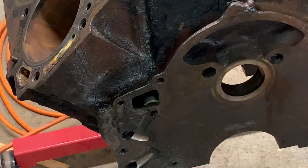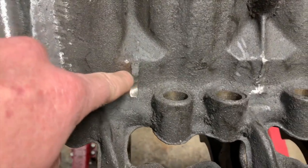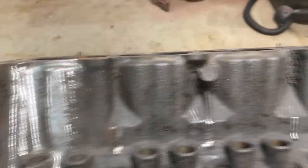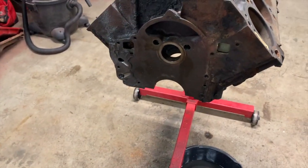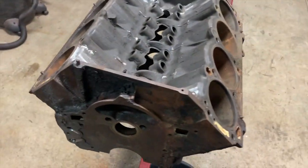Fully oil-modded and ready to go — I can take it to the machine shop, get it all boiled and cleaned and ready to rock and roll. I know what you're thinking: 'Hey, you forgot to take the casting flash out of the block.' Well, I did come back out and finish it up, so I'm adding this to the video. I cut the casting flash out and those six extra casting bumps that were in there — ground them down to the casting nubs, then polished all the oil return areas and the pump pickup and pressure side. Ready to go — definitely done with the block.